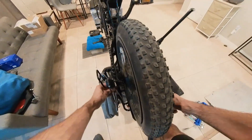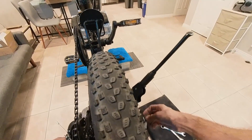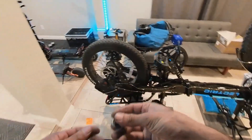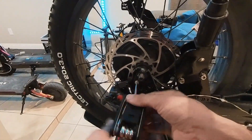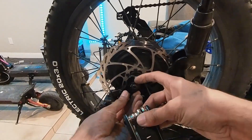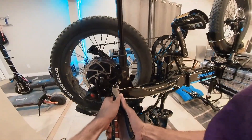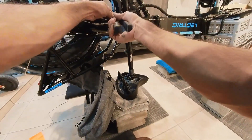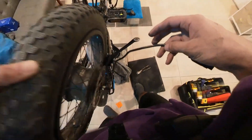Move on to loosening the wheel nuts and watch out for the derailleur cage falling out. Remove the wheel nuts and washers, and put original parts away in a safe place for later. Use a hex key to loosen the bolt and remove another washer. Move over to the drive side and do the same, then clip the zip ties holding the motor wire onto the frame. Now you should be able to remove the rear wheel — a few washers will be found on the inside, so place those aside.